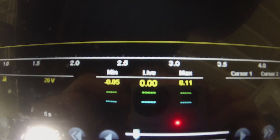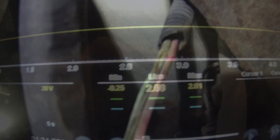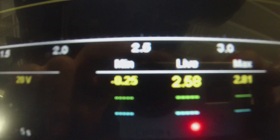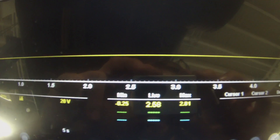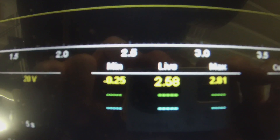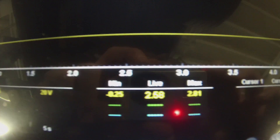What I should do is go to the module and see if we have voltage coming out. But here's what I noticed while I was out here — these damaged wires right here, and they go right to our speed sensor. Maybe I can get a voltage reading off up there. Got the wire stripped back a little bit trying to make contact — I'm getting about 2.58 volts at these wires. The guided component test said I should have 12 volts with it unplugged, but I'm only getting about 2.5 to 3 volts. So either this is normal voltage or we have another wiring issue.